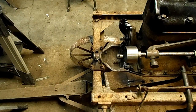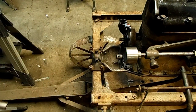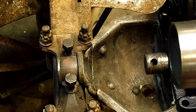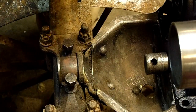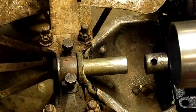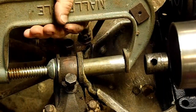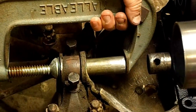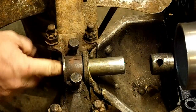We're back at it. I've been kind of test fitting some things. We have our new crank bushing, so I think we'll put that in. It sits in there and fits pretty tightly, so I'm not putting any thread locker. I'm actually going to put a little oil on it because I think it might make it easier to install. Trying to go from the back — most of it sticks out the back. We pushed it in a little ways.